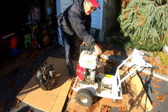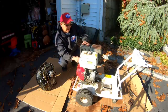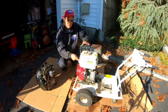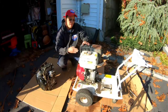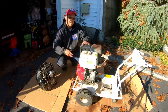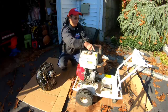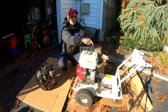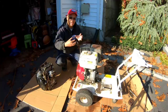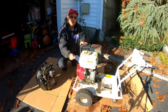It runs good. It doesn't even have a pulley on there, you know what I mean? So I would probably have to hook up some kind of a throttle cable to the governor to give it throttle and connect it to the gas pedal so that I could increase the speed of the crankshaft, therefore turning the drive shaft and all that. I'm really anxious to get the spacer for the centrifugal clutch so that I could test whether or not that clutch retracts as it should at high revolutions when you increase the throttle.